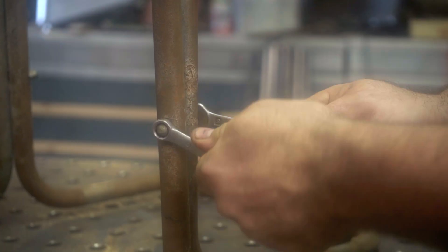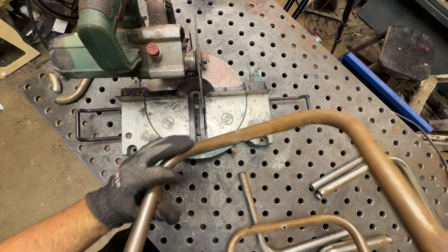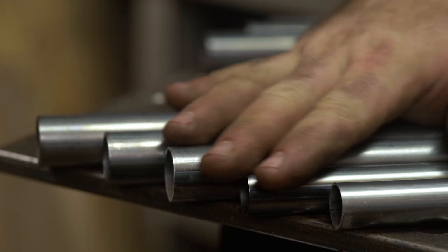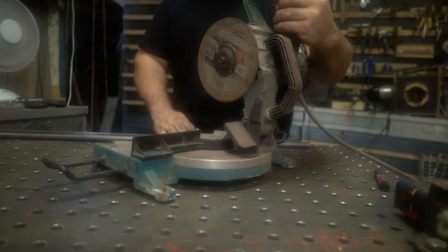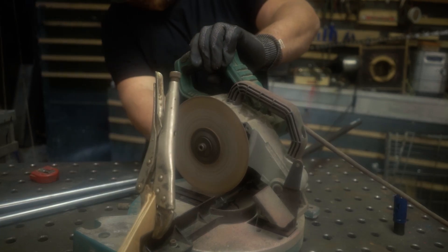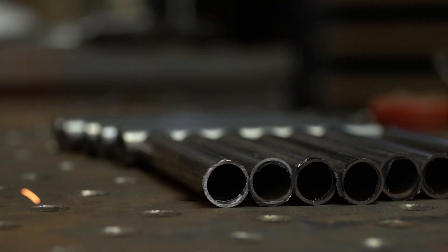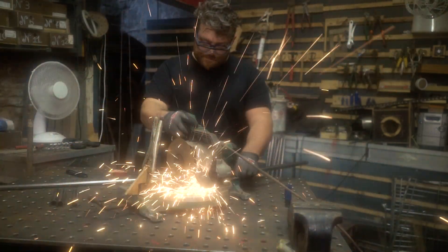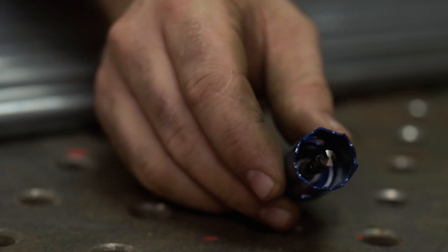Let's start by dismounting the structure of the table, because we need these 90-degree corners. But we also need longer tubes to create the structure itself, so I bought tubes that are a little bit wider than the table structure so they can make a press fitting together. Now I have to cut 16 parts all with the same length. I mounted some pliers on the side as a stopper so I can cut all the tubes to the perfect dimension and they all look exactly the same.